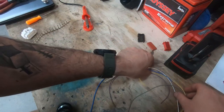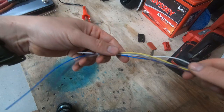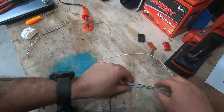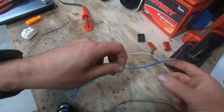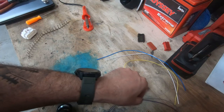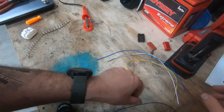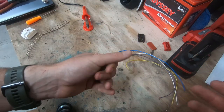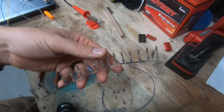So now what I did is from when I cut the Hondata wire - took a bunch of the extra wires there. I'm basically going to have left blinker, right blinker, check engine light, fuel wire, oil pressure light, and I'm going to have to grab a couple more for headlights and brights. So grab your strand of these little connectors.